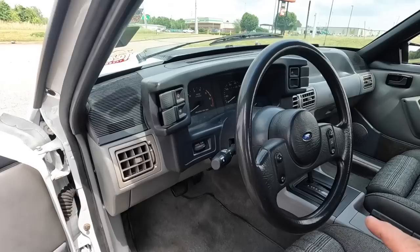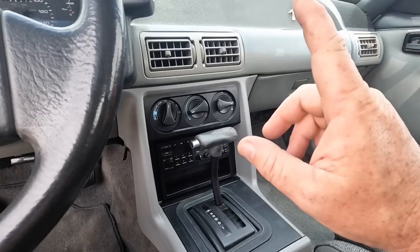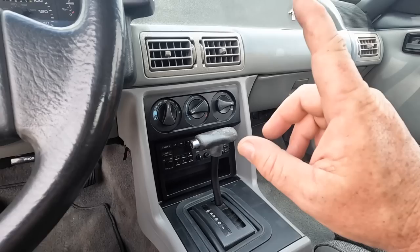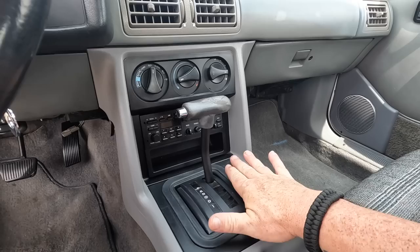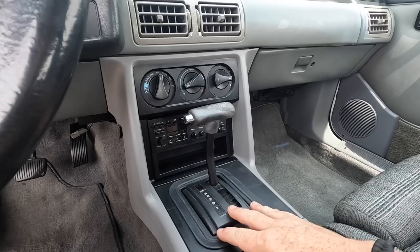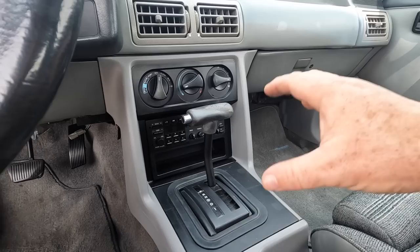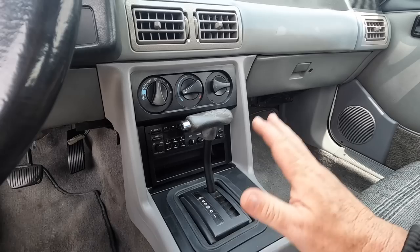Couple quick notes — we did not half-ass this. This has the actual pedal assembly from an auto in it, which is great. I didn't just tuck the pedal, which I've done in the past. The shifter is mounted properly using a floor section out of a convertible. One thing I'll recommend: we measured twice and cut once. When I went to put the console back in, we were a hair forward and a hair up elevation-wise. We moved the shifter back and had to trim the bezel to get it exactly right. Definitely, if you're doing this, measure twice, cut once — make sure you've got your shifter right because the console will not go back in the way it's supposed to if you don't.